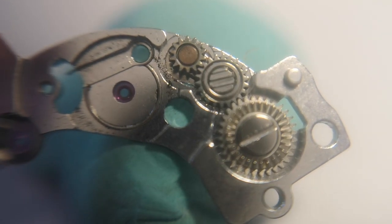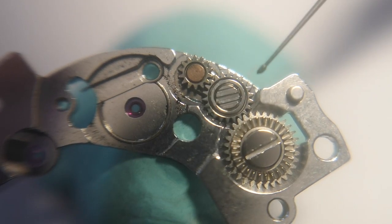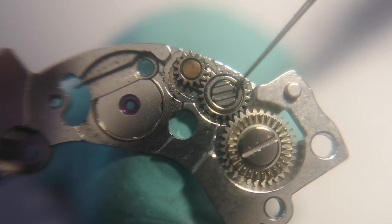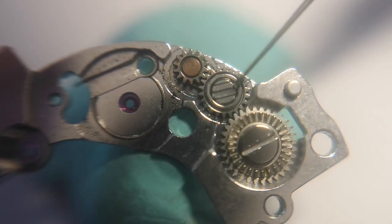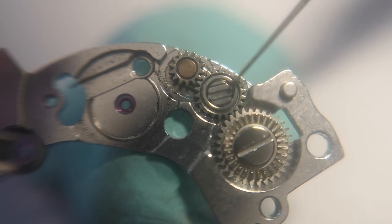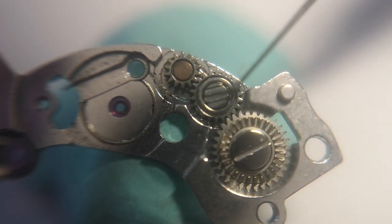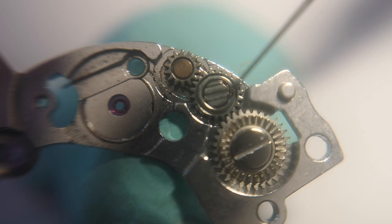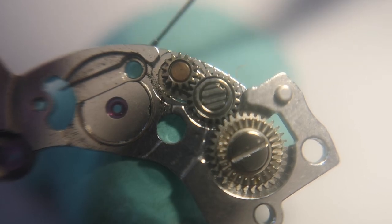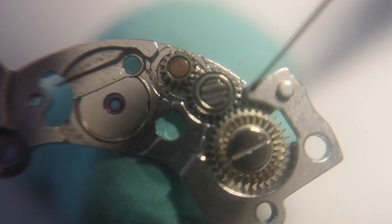The other thing to notice on here is this screw here. This, as you can see, has three stripes on it. That means it screws down in the opposite direction than normal. So whenever you see that, don't try and release that anti-clockwise and then get cross with it because it's not coming out, because if you do that, you're actually driving it in and you'll strip off the thread if you're not careful. So that's something to bear in mind there. So I'm going to dismantle this now, and then we'll get on to the rest of the powertrain.